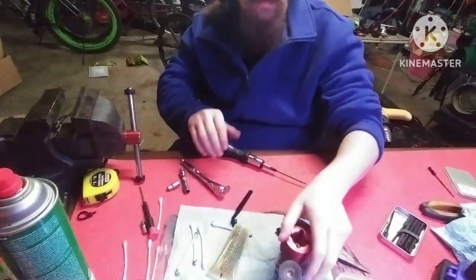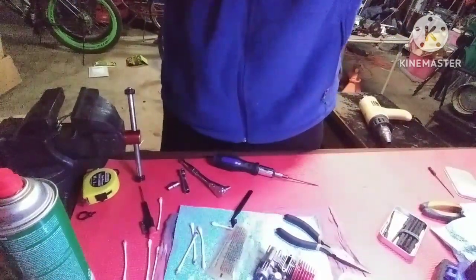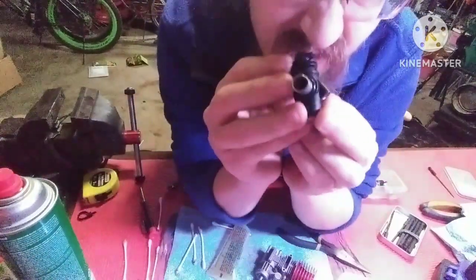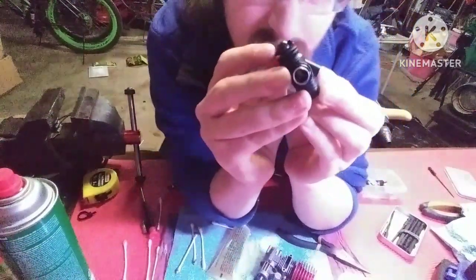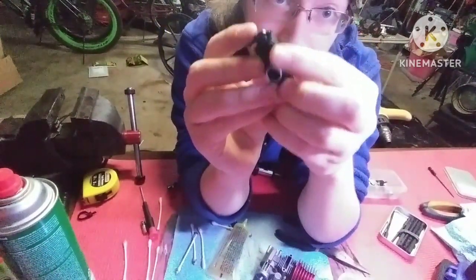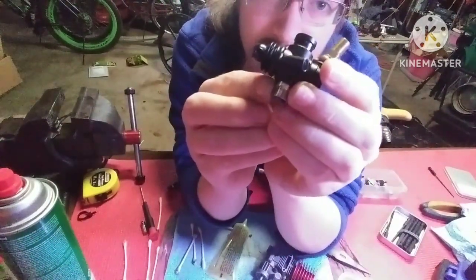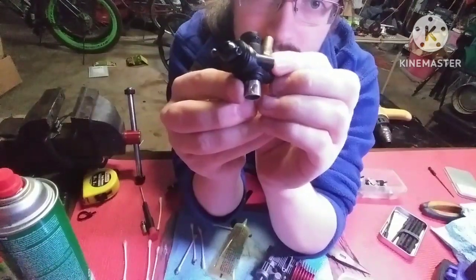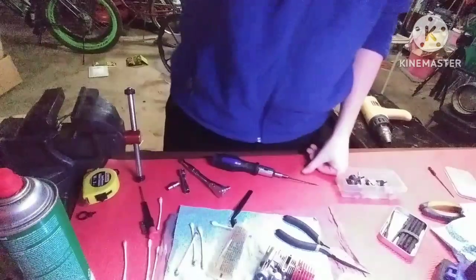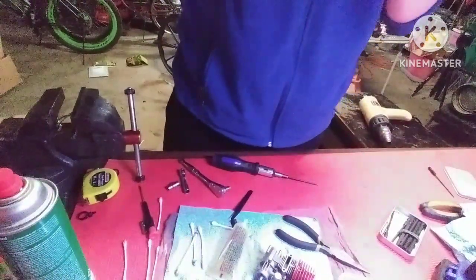Let me show you. I have crushed a Dynamite 19 carburetor, which you can see that it is no longer round. When it's no longer round, it doesn't make a proper seal, and then you end up with an air leak, and then this carburetor's toast. You can see that pinch bolt crushed it, over-tightened it. And that may be just the way that's designed, that pinch bolt. Some of these carburetors, the way the pinch bolt is designed, won't crush it.